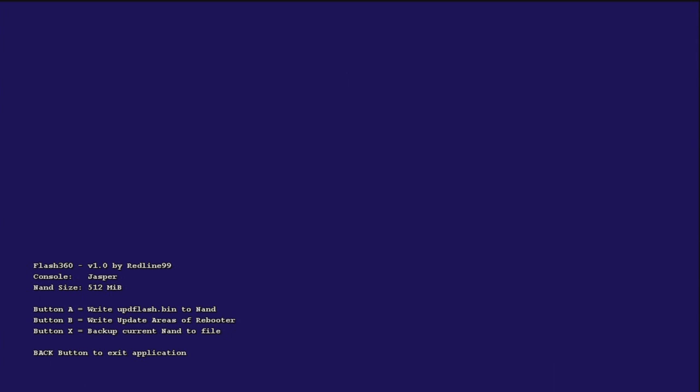After it's done completely loading, it'll say — I think it's either press A or press X to start the countdown timer. I don't want to do this again because I'm not trying to break my RGH. I'm already updated to the new dash, as you can see. You'll see a countdown timer that starts from 5, 4, 3, 2, 1 — and when it hits 1, it automatically shuts your RGH or JTAG off. After it shuts off, unplug everything. I literally took the safest route and unplugged the power brick, which you're supposed to.